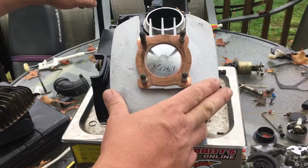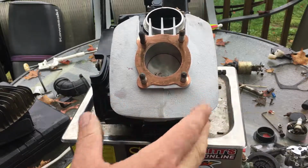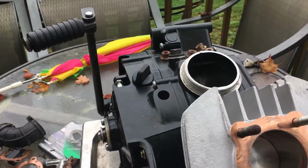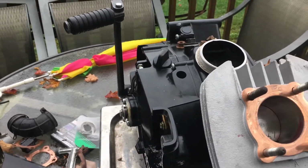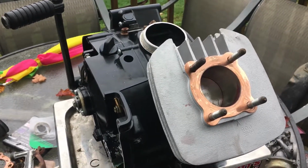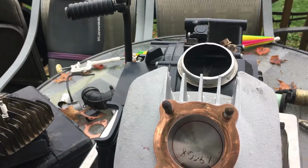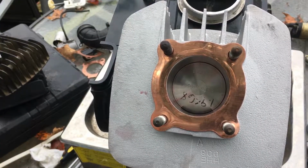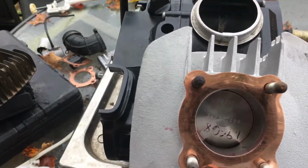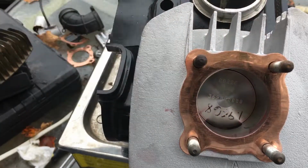So basically right now when the piston travels down, okay, it's essentially pushing the air and fuel charge. If I can get this out a little easier here, I've got stuff right in the way. Remove this heater my brother gave me. So, as the piston travels down, alright, you can see the exhaust port right there. It's already opened. Okay, now the exhaust is going out.